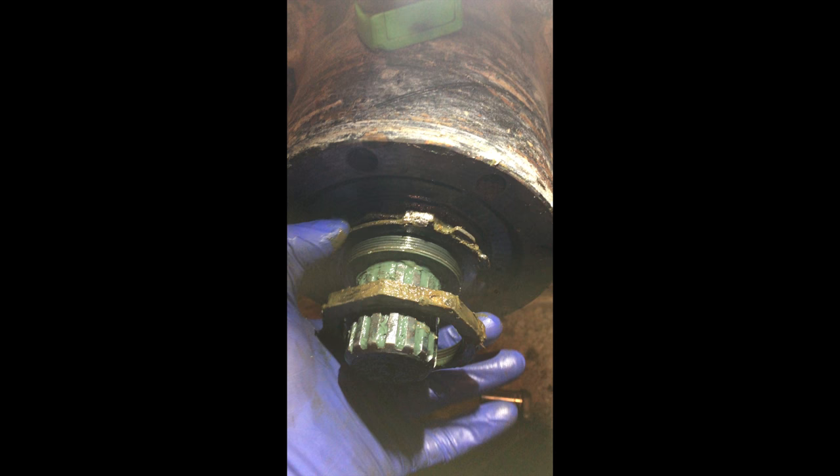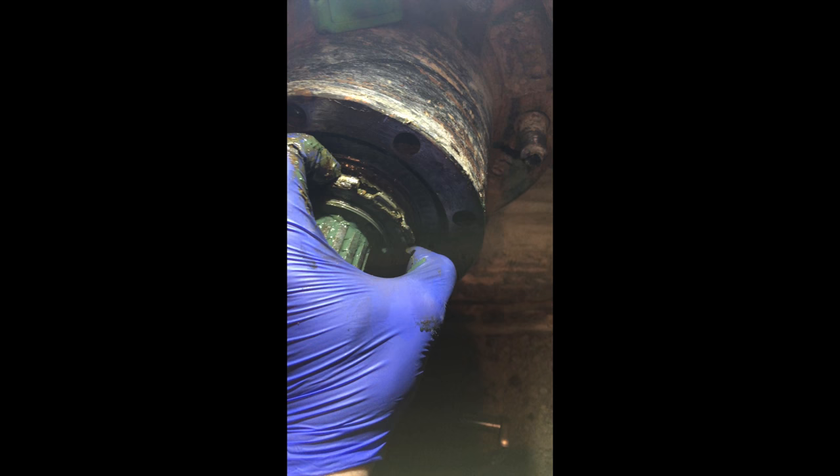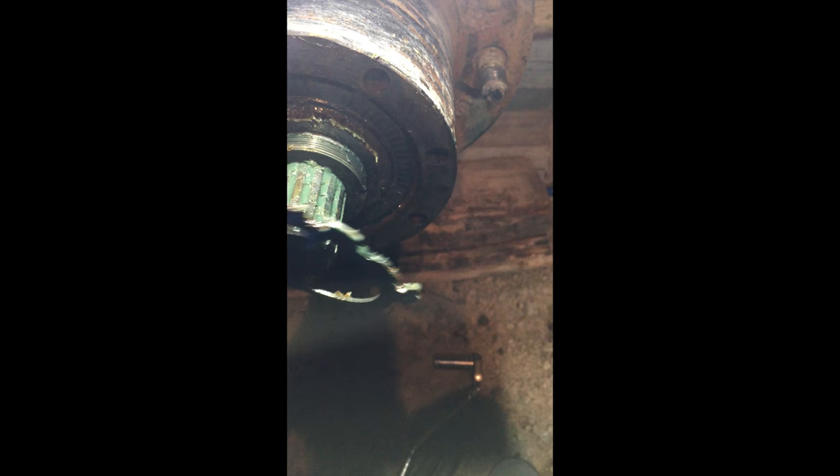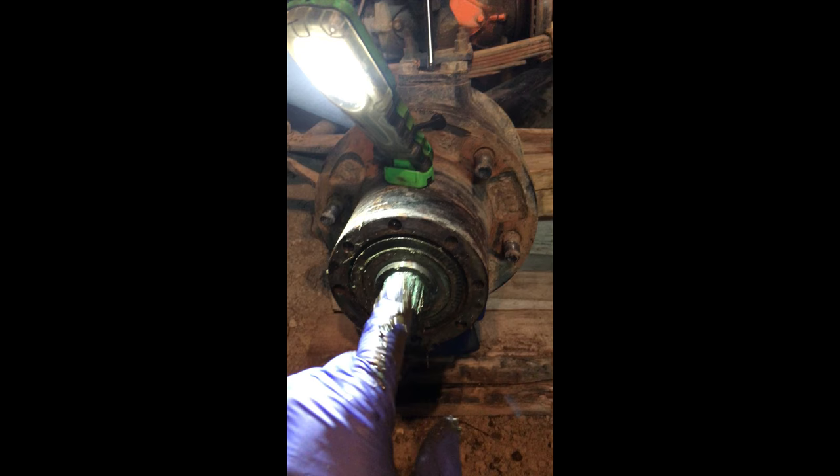On the inside there are two sets of these. We've loosened the axle nut and the jam nut — we can turn that off, probably use channel locks. Taking this outer nut off, and the locking ring is right here. This little locking tab has sides notched in to grab on the ring and the large bearing nut. Now we've got both jam nuts off the bearing.